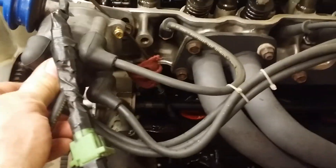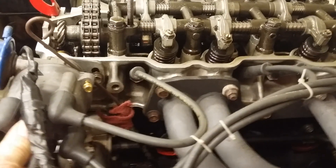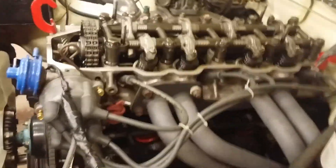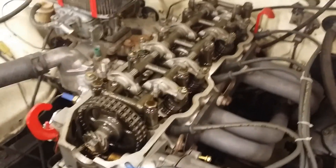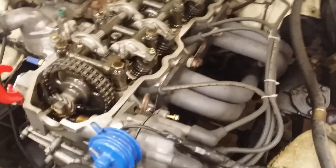So what I got here is this engine built by some professional guys. Either somebody screwed up and got something wrong, or — what I believe — is this motor was built to be a forced induction of some sort. What you can do sometimes is take a stock motor and retard the timing — the cam timing and ignition timing — to boost it with a supercharger or whatever. I think it was built to be boosted in some form or fashion, and basically it would be retarded.